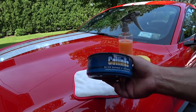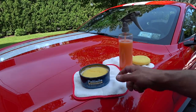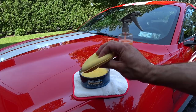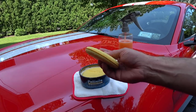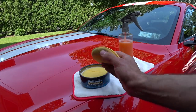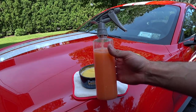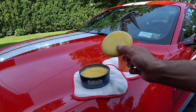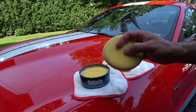What I have on the hood right now: Griot's Garage dual-weave wax removal towels — I shot a video on these on my channel. These are the yellow Meguiar's soft foam wax applicators, the wax applicator of choice that I use. All the others seem a little dense or big. I really like this one because it's easy to manipulate and get into the contours and undercuts of the body. And I have a small bottle of Chemical Guys VO7 full strength, no dilution, in a spray bottle — I always mist the pad before applying to the panel.